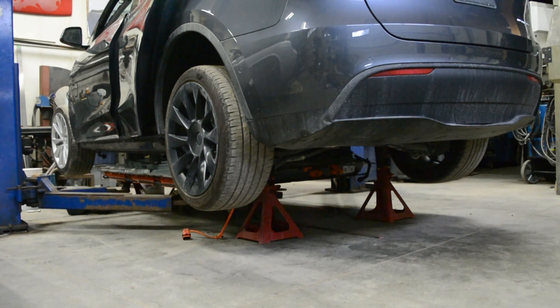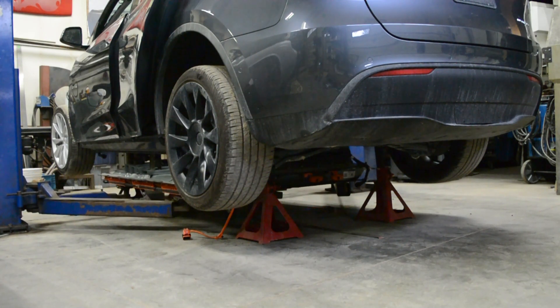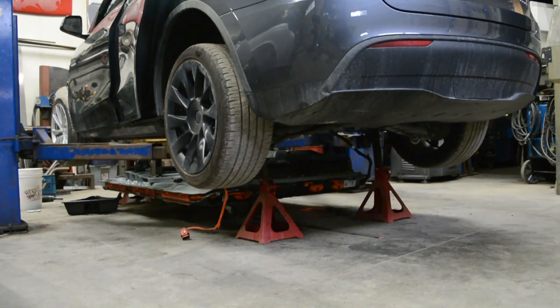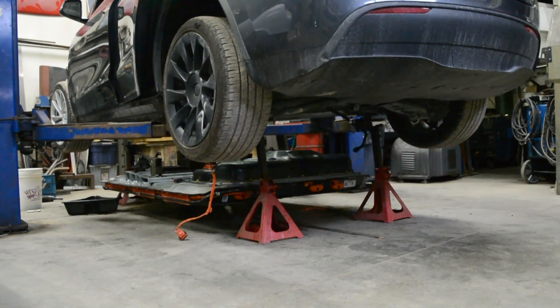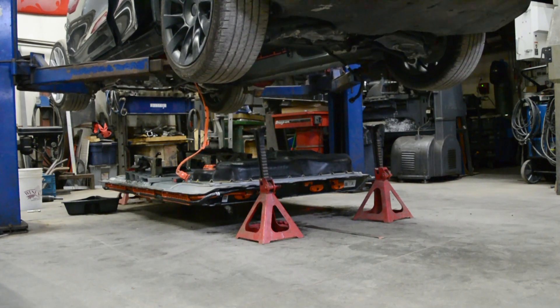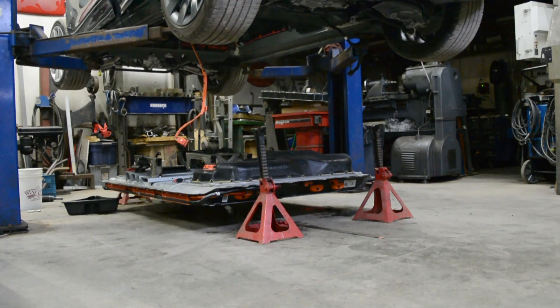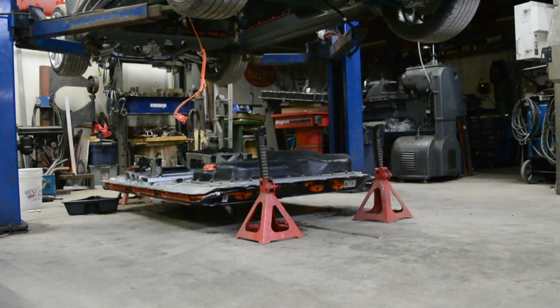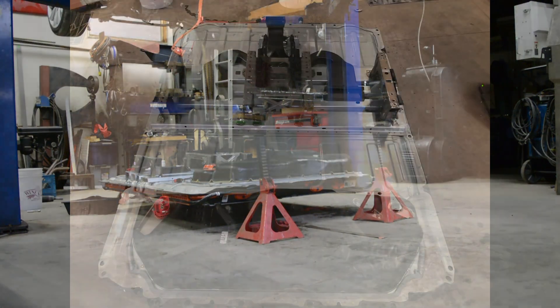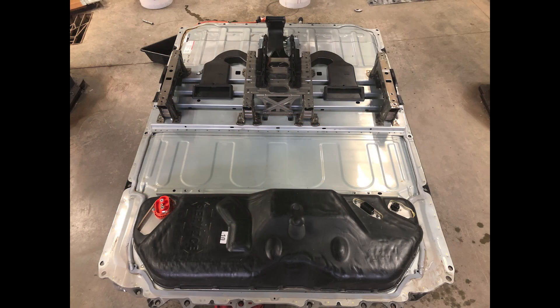Over the several batteries we've removed, I've found the easiest method is to support the car with a set of jack stands, use the hoist to physically drop the battery out onto a cart with wheels, then reposition the hoist and lift the car up. Once the car is up, the battery is on a wheeled cart and I can maneuver it around the shop wherever I need it. And that's the battery removed. In the next video, I'm going to dive into some of the differences I've found in the penthouse between this and the Model 3, and then we're going to get the top off this battery. Thanks for following along.